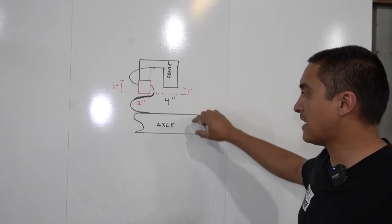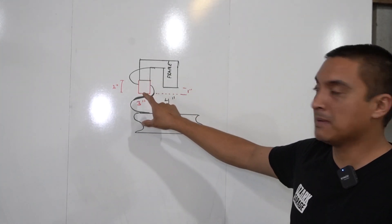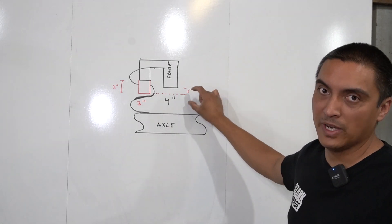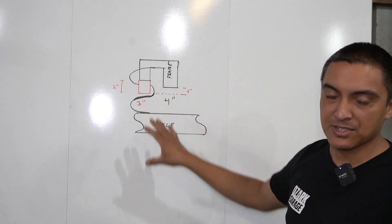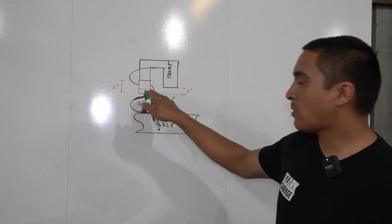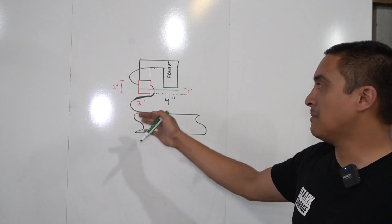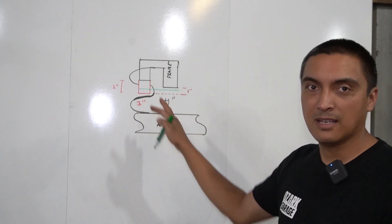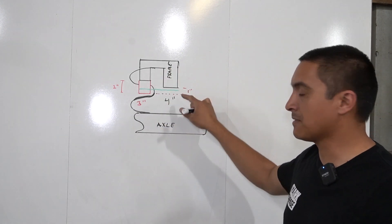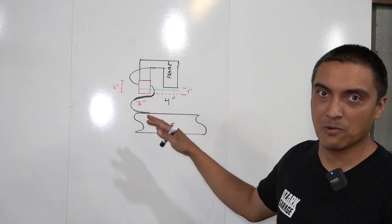Currently I have about four inches of up travel between the axle and the frame before metal to metal contact. The bump stop is set so the axle will hit it before hitting the frame, with a gap of about one inch. The current hard polyurethane bump stop really doesn't compress, but the new Perry Parts bump stops will compress about three quarters of an inch. With that compression, my axle will only clear the frame by about a quarter inch — which if it compresses any more, it could actually hit. So I could put a spacer on the axle or the bump stop to give it more standoff, but that means I'd hit the bump stop even sooner, which I really don't want, and I don't want to limit the up travel any more.